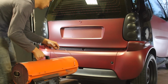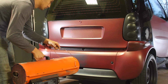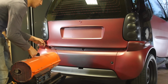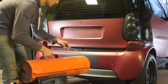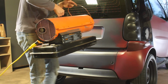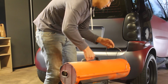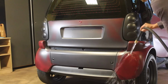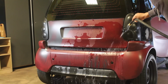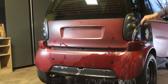What you see here is me playing around with the dip. The orange thing in my hands is a kerosene space heater that I'm using to warm up the PLASTIDIP. You can see that when the PLASTIDIP warms up, it changes from a burgundy red to a gunmetal gray. If the pearls themselves went from red to crystal clear, instead of red to opaque, you'd see a black PLASTIDIP underneath. Now what's really cool is that you can get it to go back to red in a matter of seconds. Grab a hose and cool the dip down, and it goes right back to that red burgundy color.